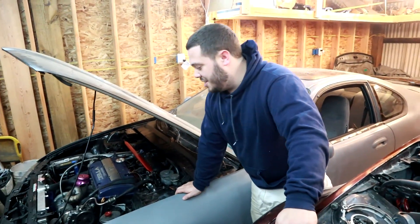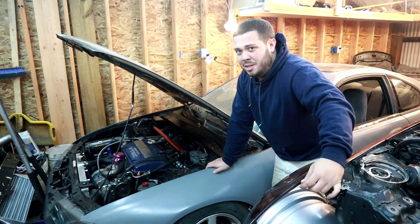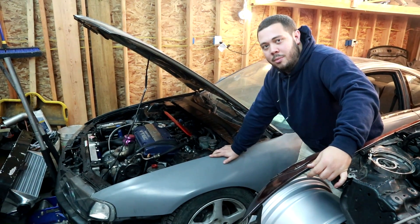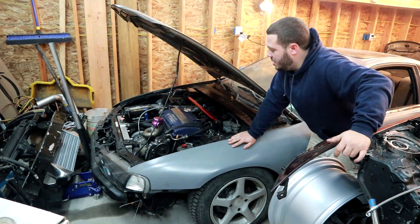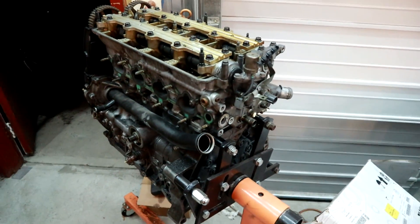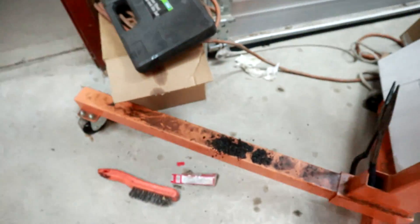If this video gets 100,000 likes, Damien will get a Mugen bumper. Fourth-gen Preludes aren't a common car to mod — not a Civic — but shout out to Boosted Boys for having a Prelude. I'm going to tune this at 6 PSI right on the wastegate spring — just a nice daily driver I'll try not to blow up. I also have a spare F20B engine donated by a viewer, plus extra pistons, crank, block, head, and cams.